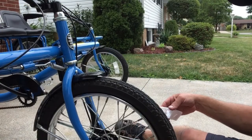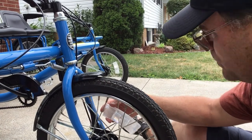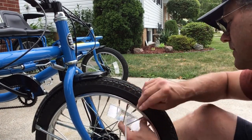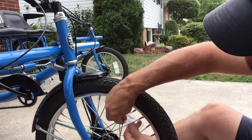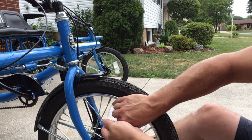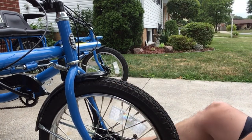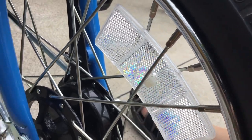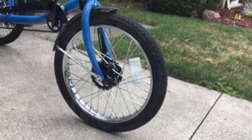You'll find there are two rows of spokes — fit the reflector between the two rows with the groove lined up on the other side. Pass the tie wrap through on one side of the spoke and come back through on the other. You can see where I cut the excess tie off — the tie wrap grabs the spoke and it's on there pretty good. I did the same on that bike about a year ago and that reflector hasn't moved.